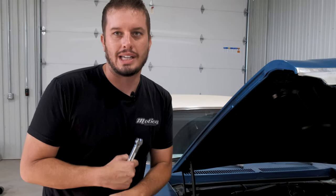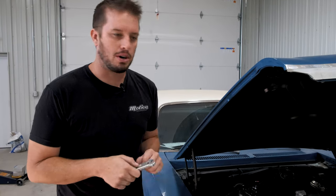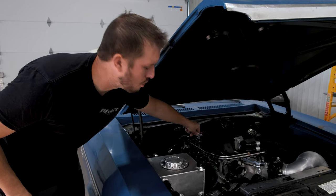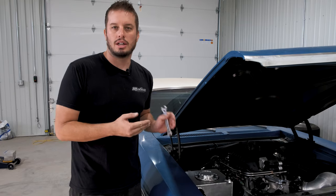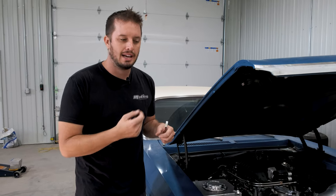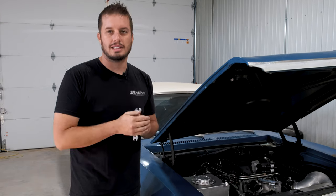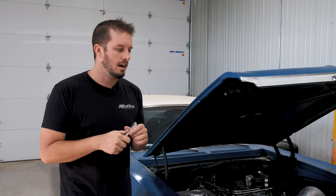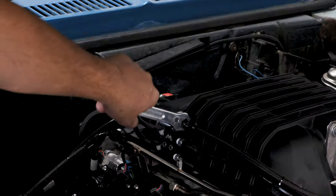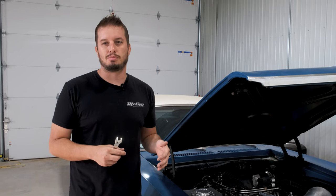You're going to want to use a towel or something to protect yourself, so do this at your own risk. You don't want to unscrew it and take it off because you might have steam and hot water come out. Use gloves, use a rag, use your own common sense to make sure you don't burn yourself. But you can basically take it from full tight and just crack it, and you'll see it and hear it start to hiss. It'll let the air out. What I typically do is do that before the thermostat opens — when the motor's cold, just let it run for a few minutes like that. It'll drip a few drops of water and let a bunch of air out, then I'll tighten it. Once I see the thermostat open — aka the temperature is to the point where the thermostat would open — I'll do it again and let it run for a few minutes, just hiss and steam and get all that stuff out of there. Eventually you'll see it start to stream water. Then you want to close it up, and typically that's about all you really need to do to bleed the whole cooling system. That is one of the benefits of the steam kit being the highest point on the system.